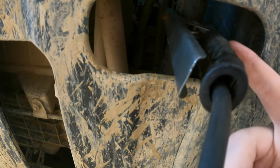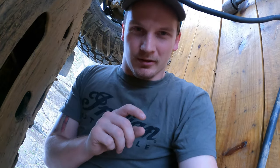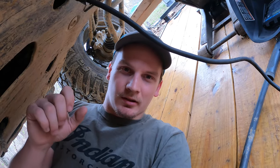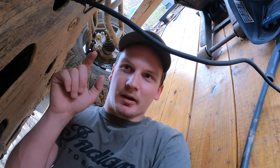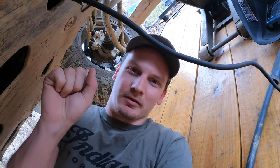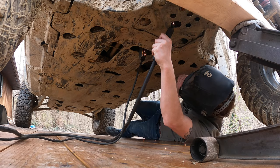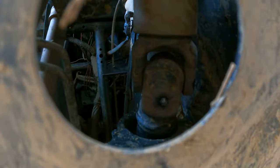I just put the ground on the driveshaft down here and I already put one tack on one side. The thing to keep in mind is you don't want to get it too hot because then it will burn up the grease inside of the U-joint. So tack it, let it cool off, tack on the other side, let that cool off, and then we'll have to put it in neutral to turn the driveshaft over so I can get the other two sides. You don't need much.